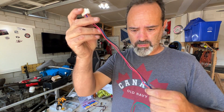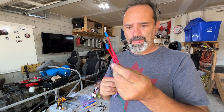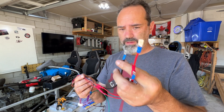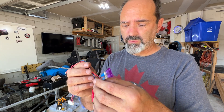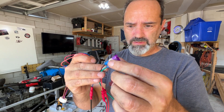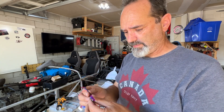My gauge plug wiring is going to ignition positive, lights positive, ground, and that's my little inline fuse — just a 3-amp fuse for the signal wire. If that works fine I'll just put a proper connection between these two, but if that blows, obviously the ground and the signal are the wrong way around in the trunk. Not my fault — bad instructions, what a surprise. Let me hook this up and see if anything works.